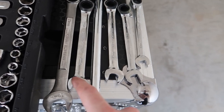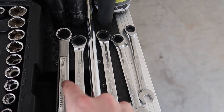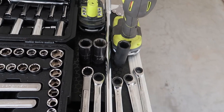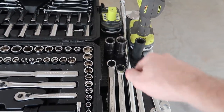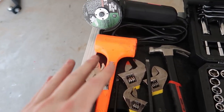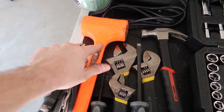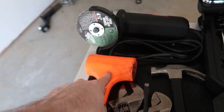You're going to need a variety of wrenches — 19, 15, 14, 13, and 12 millimeter. The main ones are 14 millimeter and 19 millimeter, and my 14-millimeter is a ratcheting wrench, which is very handy for tight areas where you can't get a socket or your impact. Moving on to the persuasion section: you're going to need a sledge or a dead blow hammer. Hammers are super important for this install.